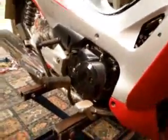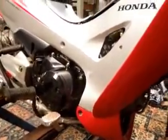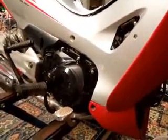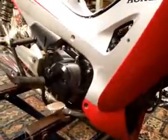I'm going to do a big service on this one. I drained the oil while it was on the floor on the centre stand, but now I've put it onto the bike ramp. There's apparently a strainer on the other side — I've finally got myself a Haynes manual for it. There's a centrifugal filter in here and some sort of strainer as well.